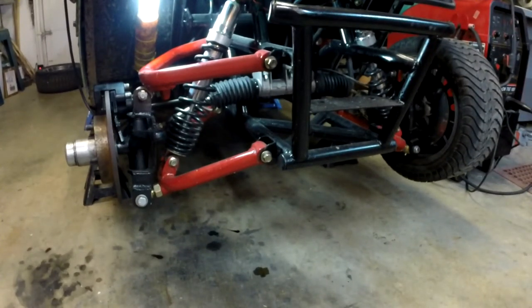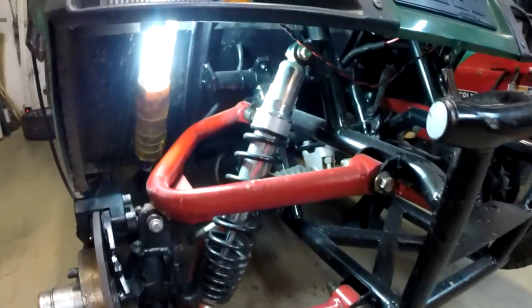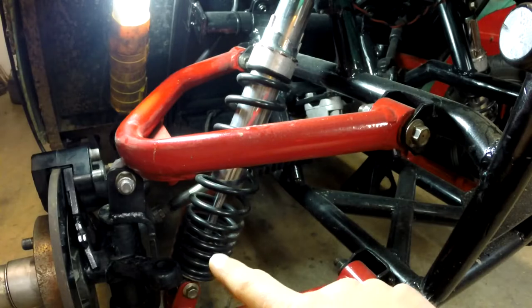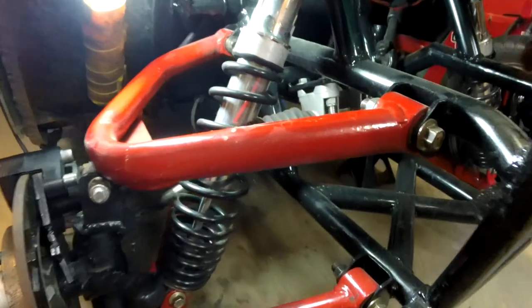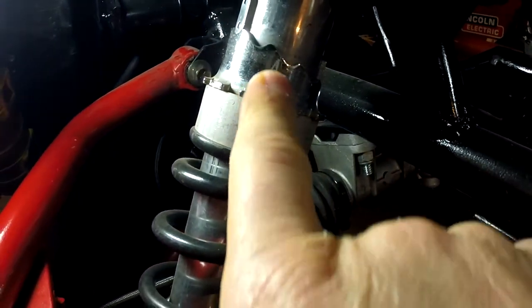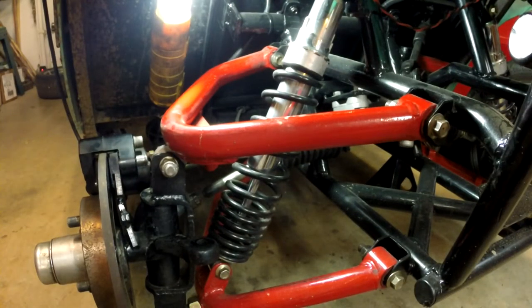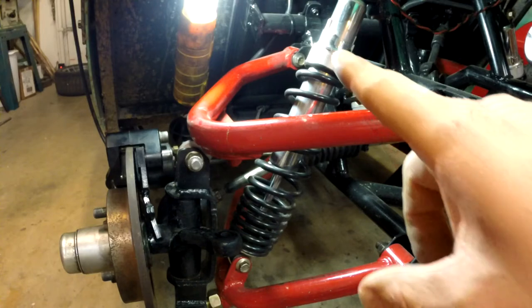Another thing I had to deal with was the shock. I lucked out with the spring rate — I basically used the shocks that were on that buggy and they turned out to be pretty close, though actually a little soft. They're a dual-rate spring. I took the whole shock apart and added a three-quarter inch aluminum spacer because I had it maxed out and the front end was sitting a little low. Adding that spacer brought the front end up. I could have ordered a stiffer spring, but I liked the softness — I just didn't like how low it was sitting. As you're doing these custom builds, you just run into things like that and find ways to make it work.